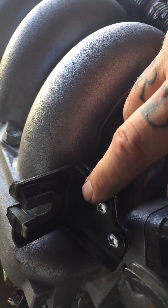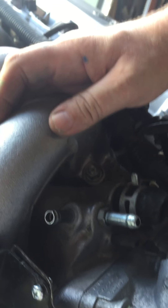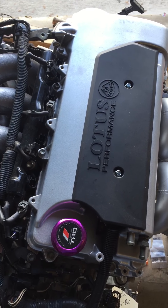I did this little fabrication on the throttle cable because there was really no means to connect it. I made a little video showing how this was made, but here it is again. This is the bracket that came off the original — really nowhere to mount it — so I just made a little L-bracket. You can kind of see the shape of it, bolted to the intake. I did a little test with a zip tie to see if it lines up, and it seems pretty straightforward — about the right distance. Hopefully it works. I'll keep you guys updated, and hopefully my next video will be putting this bad boy in the car.